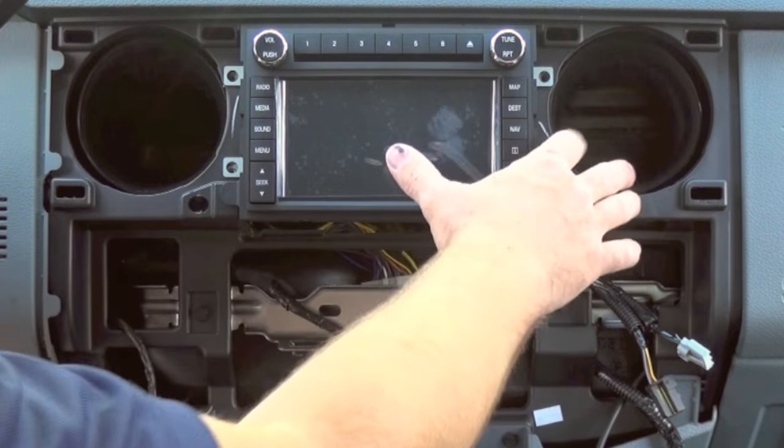When we first installed the radio, sync wasn't working — that's why we had to install that XB2 harness. Now with the harness installed, sync responds perfectly: saying 'audio,' 'radio,' and '101.9' all work. You'll notice that feature now works perfectly and will also work with your Bluetooth phone, including streaming audio.